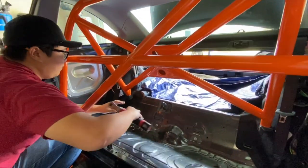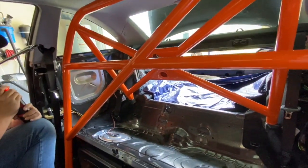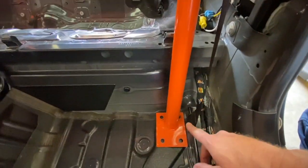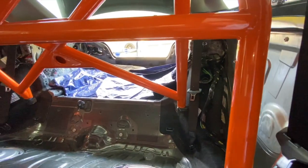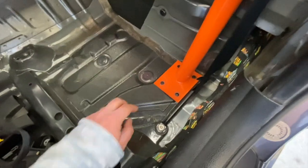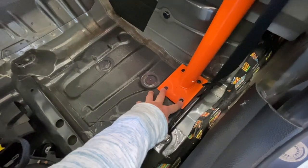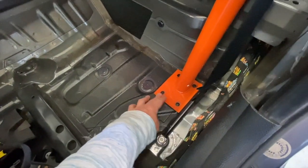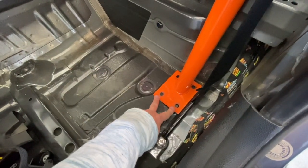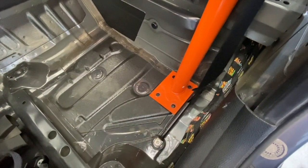Now that we have this in place, the bolts have little slots so the cage has a bit of play left to right - ours ended up pushed all the way over to the passenger side which helped them line up the most. We're going to tighten the back bolts. The plan for drilling the front two: we'll leave the whole piece in and drill the front two. On the bottom there's a plate that goes underneath, and we're going to use that plate as a template for the back two since it's tough to get a drill down there - we'll drill those back ones from the bottom.